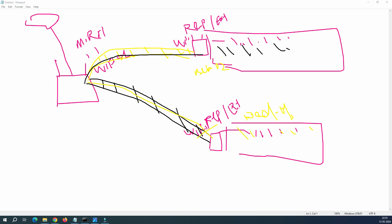One important thing I must tell you: this wireless repeater mode will bring your wireless speed down to 50 percent less. You heard right — if your main router is giving 100 Mbps, after configuring extender mode you will only get 50 Mbps. That's because it works on half duplex.